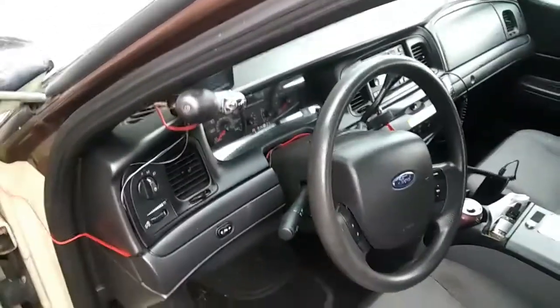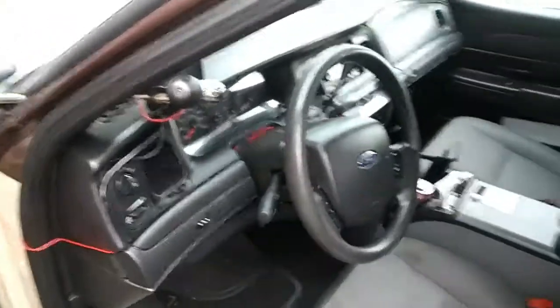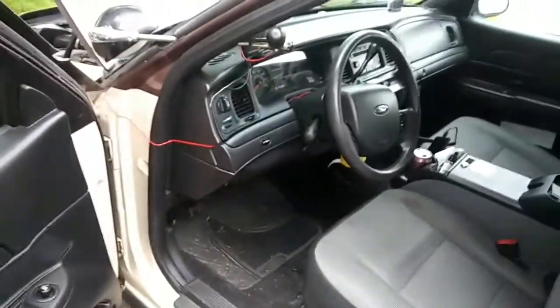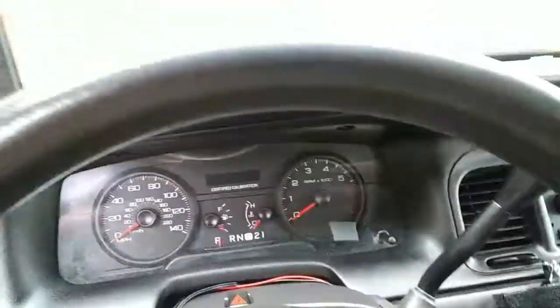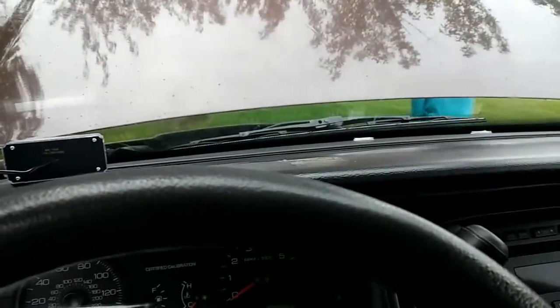But the control unit backfed power into that wire. The best way to think about electrical is flow, like water through a pipe. What it did is it found the weakest point in the wire, and it burned it out. Now, a cool little side effect to this is I don't even have to have the ignition on to turn on the wipers. I turn power on to the fog lamps, the control unit works, and I have wipers.